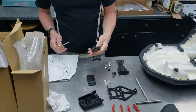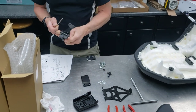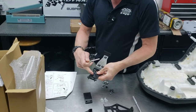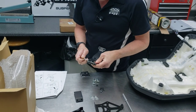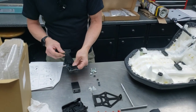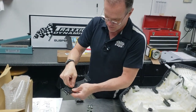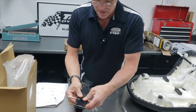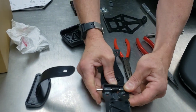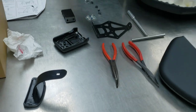This bracket and the main seat bracket are what we're going to be assembling here. As shown, the well nuts are up and the seat bracket mounting tab will be up, so you'll start the pin — and of course there's a spring. There is a bent end to the spring; that's going to go down on the assembly, so bent end down, flat end against the plate. Push on that and get the pin to pass through to get everything aligned, then check the action and make sure that's working.